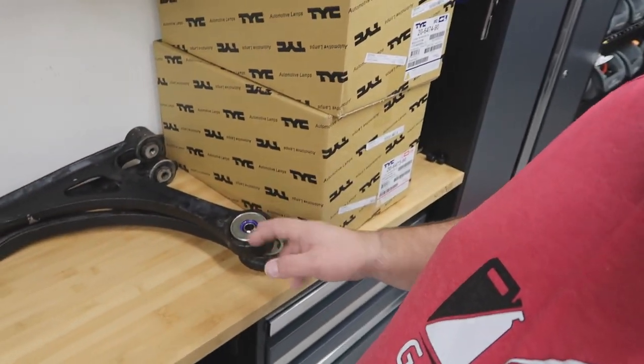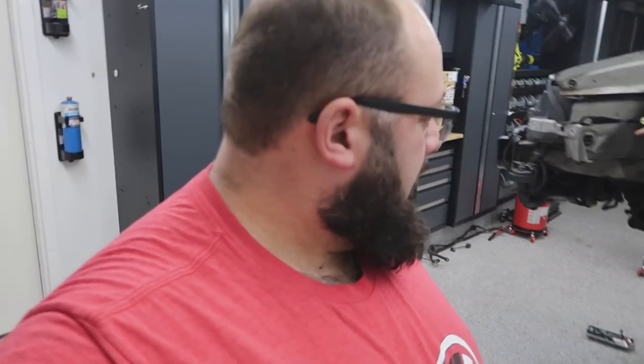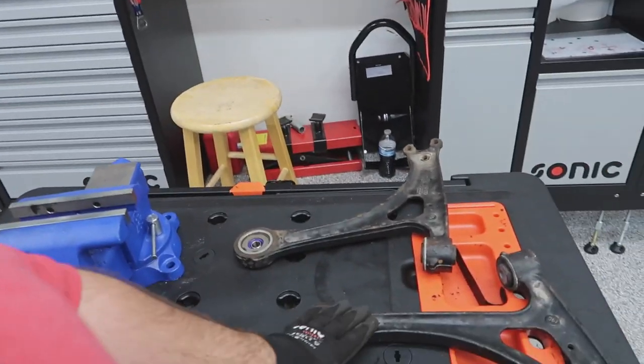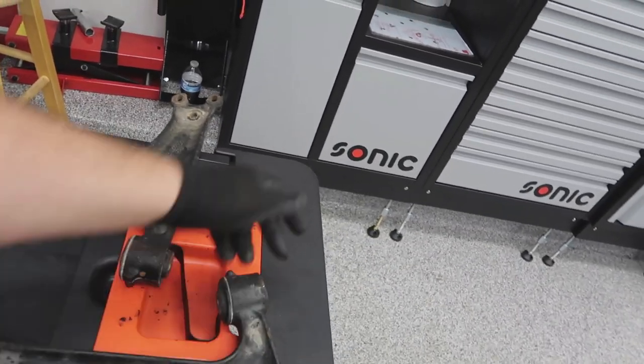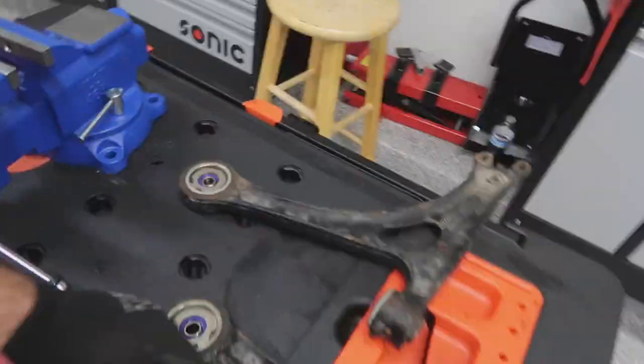Where I got stuck last was putting in new bushings. I got these pressed in at a local shop, and I need to see if they were done correctly before I start putting them in. I also fixed the dog bone. I just confirmed with the Humble Mechanics video that the shop pushed the bushings in correctly — the top side needs to be flush. These are a bit different from Humble Mechanic's, but such is life. The shop wasn't able to get these ones out, so hopefully I can. It looks like you have to push them out this way — fingers crossed.